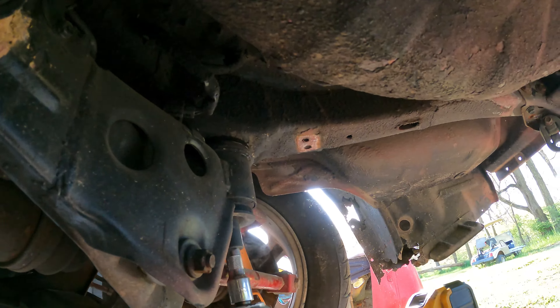Not going to drop the subframe all the way yet — let's get the jack under it. We actually need to remove the shocks or coilover upper bolts from the chassis, then this will be ready to drop. Holy crap, these things are completely loose — how have I been driving this? I honestly thought the saga of what the previous owner did to this car had stopped, but I was sadly mistaken.